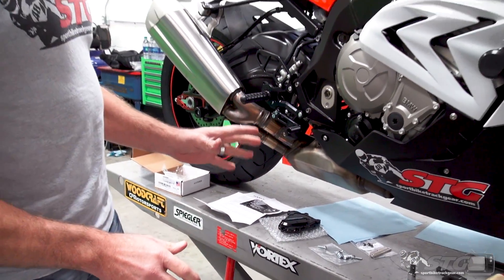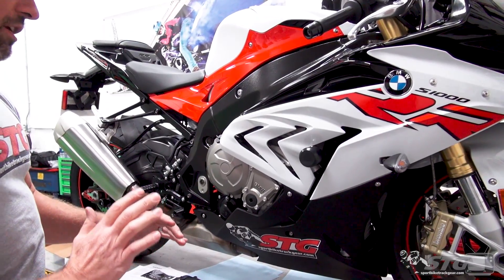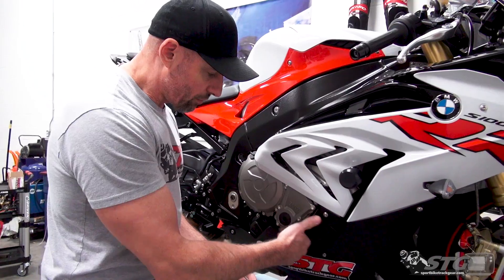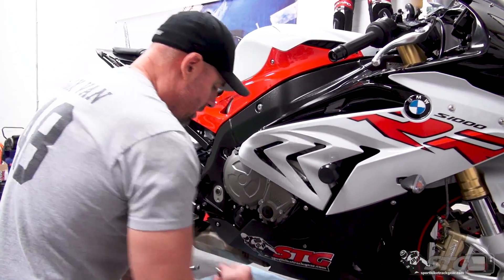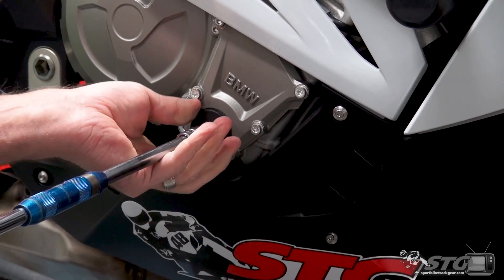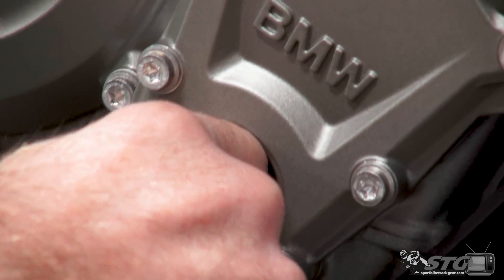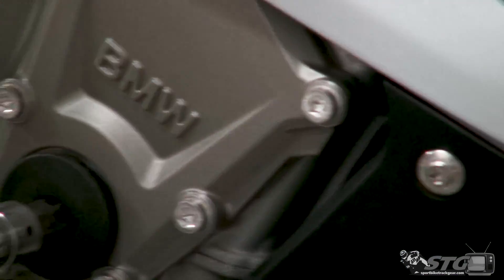It also makes note of the oil level — if you don't want to drain the oil, you may need to tip the motorcycle over to the left side to reduce the oil level on this side. What I did is I just pulled this little inspection plug to get an idea where that oil level sat. You can see the oil level is well below the bottom of this cover, so we don't have to have any concern for that at all.